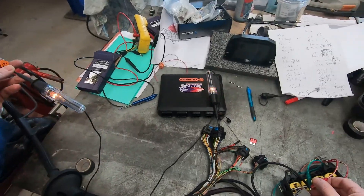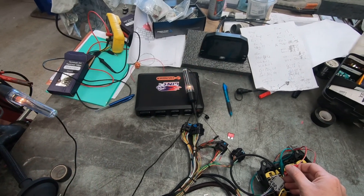I actually found it because I could hear the relay clicking - I had that start signal going to the ECU and I was going to check that and I couldn't find it. So pretty straightforward, problem solved in the workshop before it got into the car. Now that's more like it.